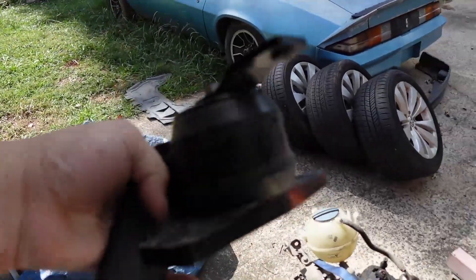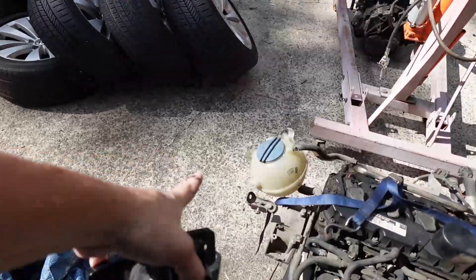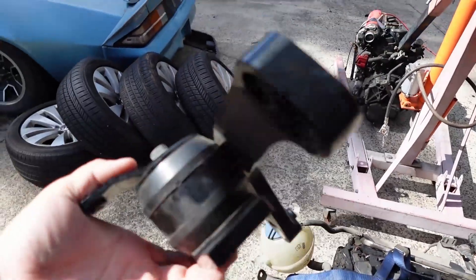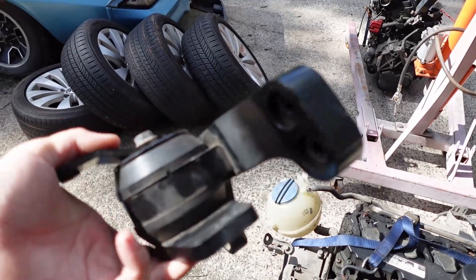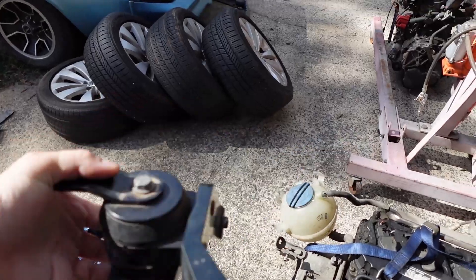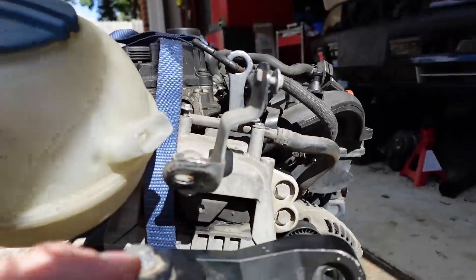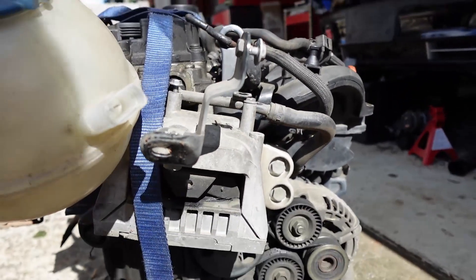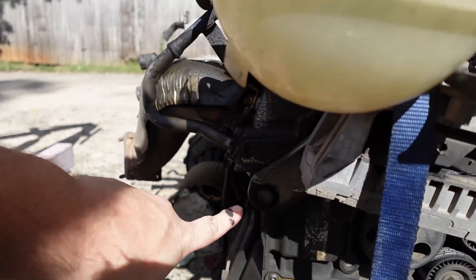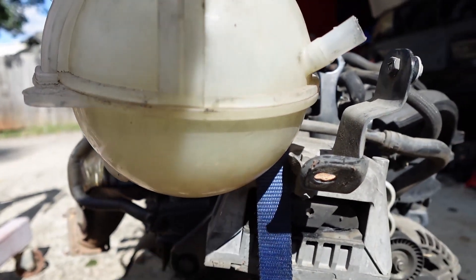Then I have this mount — this is a 2.5 liter specific mount that you have to have. I could run the factory mount, but since I'm upgrading the trans mount anyway I want to upgrade this one too. I picked it up pretty cheap — off a part-out for like 40 bucks. It's just some no-name poly mount. This one will mount up on the side of the engine right there. I've got to drop these bolts out and then take out this one bolt over here to get it all off, which will make it really easy to just drop it right into the car.